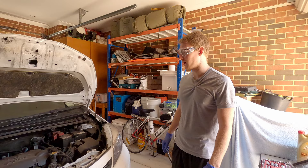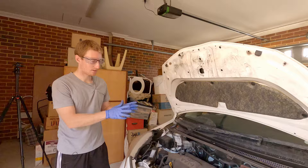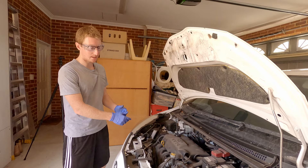While we're waiting for the oil to drain, we're also going to loosen the filler plug at the top of the engine so we don't end up with any vacuum inside the engine that stops the oil draining out — similar to using a watering can where you need an air release at the top so the water can flow out. While the oil drains, we'll do everything else for the service and come back to put the plug on and add new engine oil.